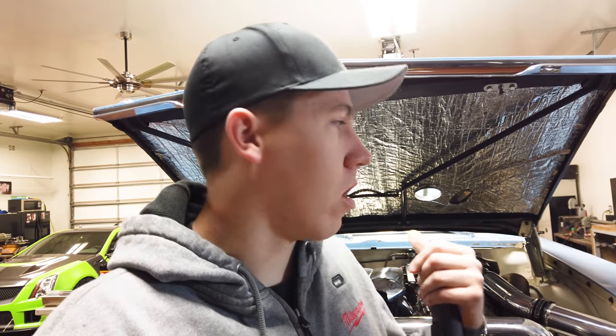Hey everyone, so another video coming at you today. We got some issues we think. We're trying to head to Texas 2K in a couple days — it's Tuesday, it's Saturday — and we've been running the car, and ever since we very first fired it up, as you guys can see in all the videos, the right bank, which is the driver bank, has always been really rich. Three sets of injectors, all sorts of different stuff. We even went as far as putting two different O2s in the car and it's still rich to that bank.